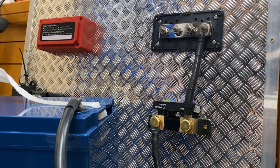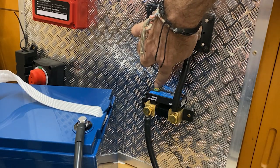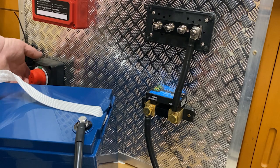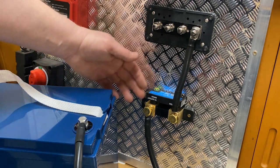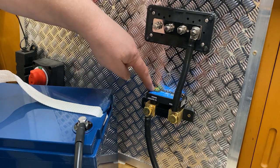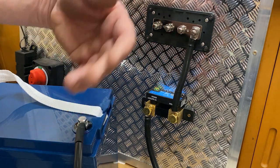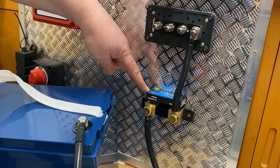Now we need to give the shunt power. We've got two ports on top of the shunt - the main power and the AUX port. The main power: we take this and put it to the inside of the switch where it comes from the fuse to the switch, giving us a constant power. This wire has got an inline fuse in it, so we don't have to worry about fusing. Any time this loses its power, it can reset to zero and you lose your settings.